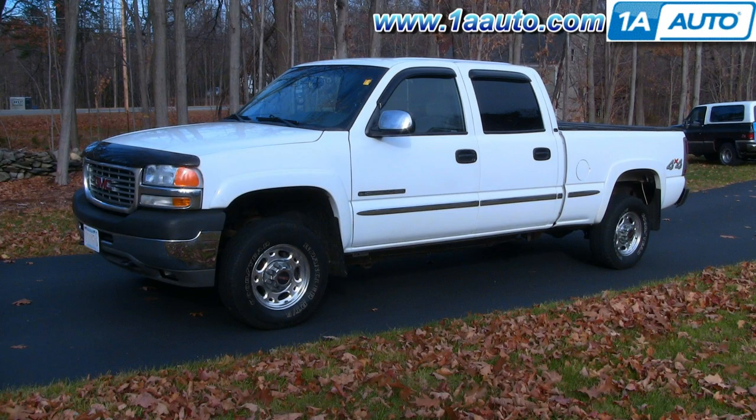In this video we're going to show you an oil change on this 2002 GMC Sierra 2500 HD. It has the 6-liter gas motor. Tools you'll need are a 15-millimeter wrench, maybe a hammer if you don't have a big wrench, and also an oil filter wrench, a rag, and obviously oil and an oil filter.